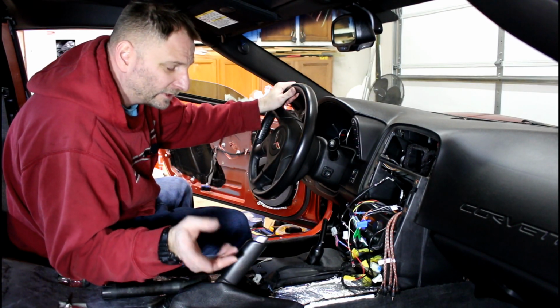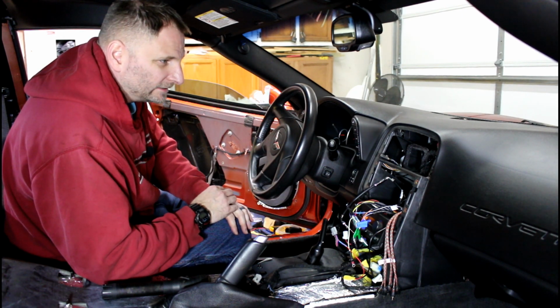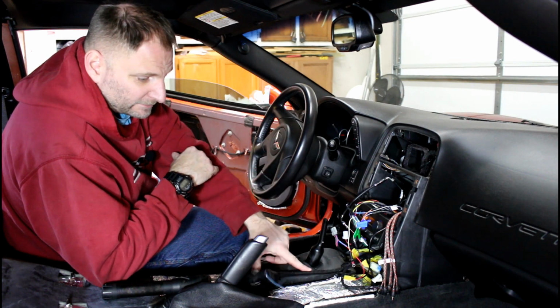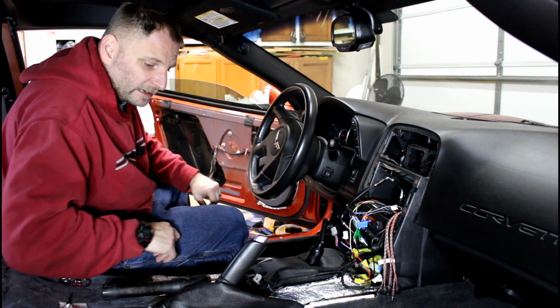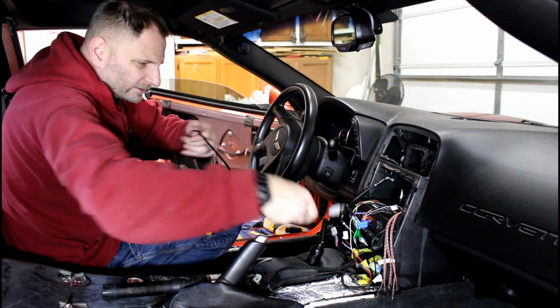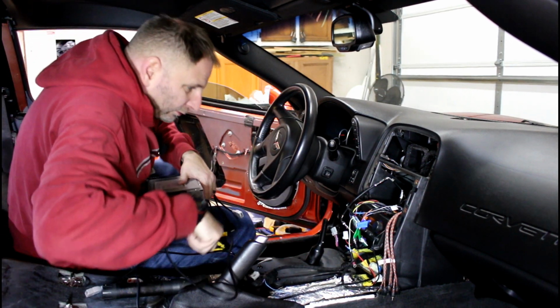All right, our amp hooked up. We still got a lot to do. I'm going to put the head unit in. That way, it can just be mounted and be held in. I got to route the USB cables that are going to come. I'm going to have them come out in the console. So I figured I might as well go ahead and do that. In the Kenwood manual, when you attach these USB extenders, they recommend using electrical tape. I will be doing that.